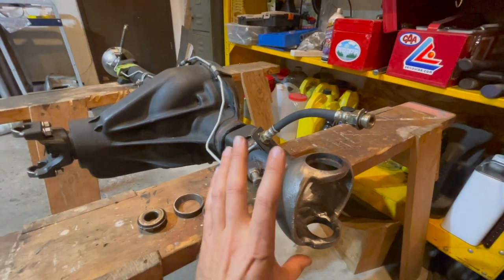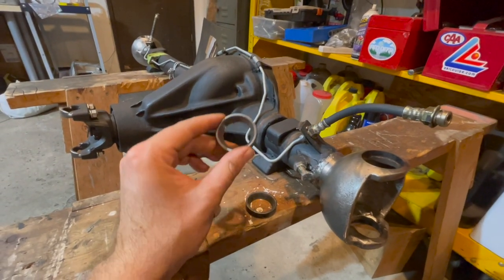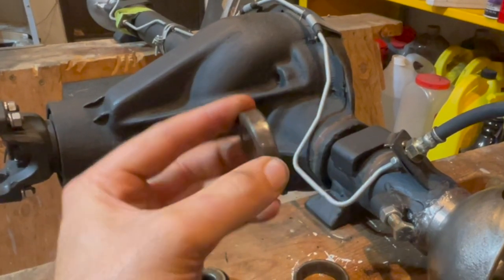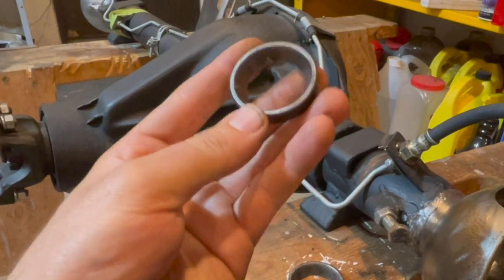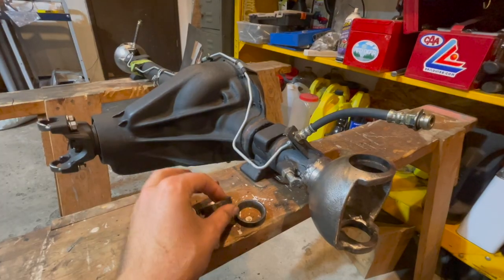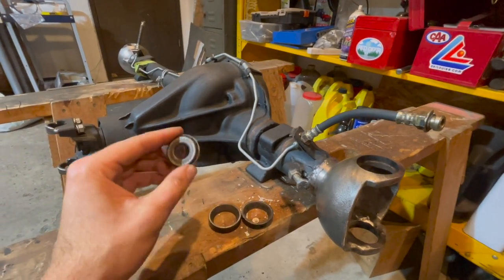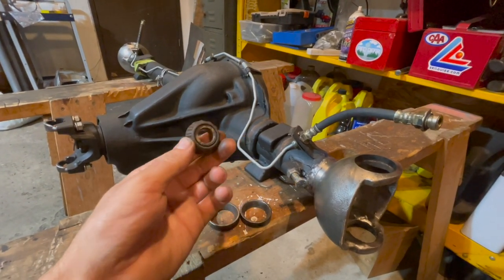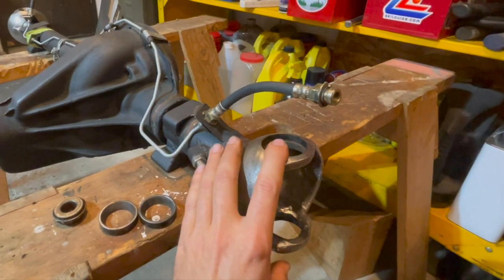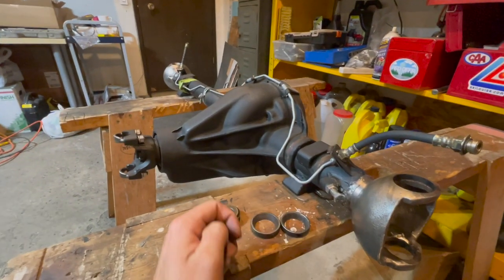Make sure that you get these replaced with new cups — there'll be no ridges on your new cup, and this will be a big improvement in your steering. Replace your cups as they cause lots of grief with that jerky feeling steering. We'll also get our bearings replaced and repacked with the proper grease in our knuckles, so make sure to watch the other videos on how to properly rebuild your knuckles. Thanks for watching and make sure to subscribe.